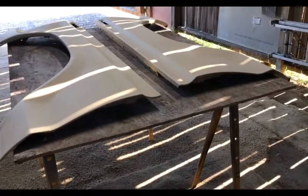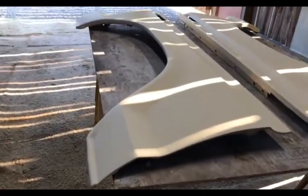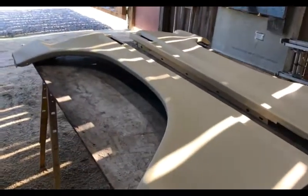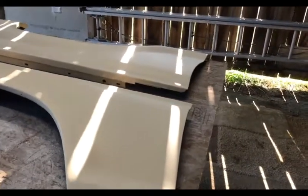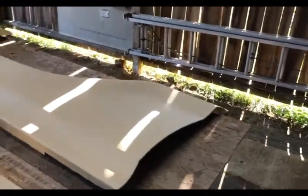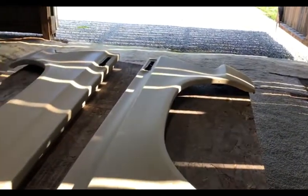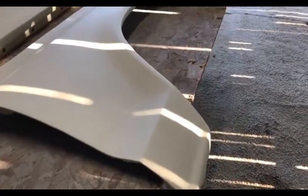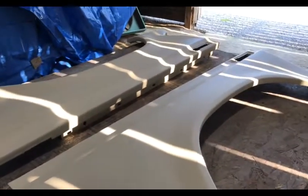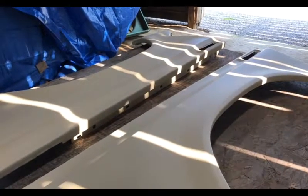I had it set up mostly in the gun I was using. I couldn't get it all out of the cup. After an hour or so of work, I did get the gun cleaned out and operational again. I bought another paint gun at Tractor Supply, along with more lacquer thinner for cleanup purposes, and used the cup there. So that was a $20 mistake on my part. In hot weather, my tip for this Feather Fill is to keep a close eye on your gun. I had set it down for 5 minutes waiting for a recoat, and that's when all that happened.